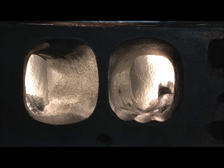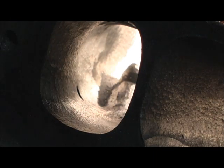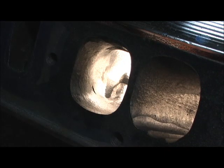Let's take a look now at the finished port from a side point of view. As you can see, that whole area right here — remember how thick and bulged up that was? And of course that's the hole where the rocker stud goes. Raising the roof up, dug that out, pulled that out of the way, and we've got a much better shot. Now that hook port is going to balance out to that port. It's amazing the CC difference between the two before you start. I'll CC them both at the end so you can see how well it tries to balance them out and get the flow numbers pretty close to each other.